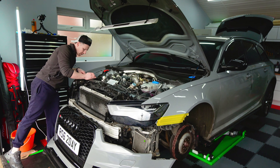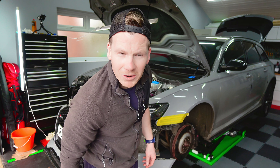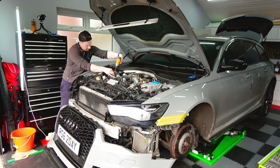I've just turned the engine off and the fans have kicked in, so that's a good sign - that means I've done something right. The first thing I'm going to do is pop back on the strut brace. There are five M10 splines to go on, all torqued down to 20 Newton meters.